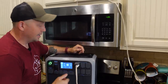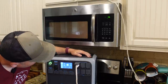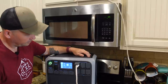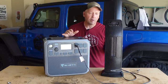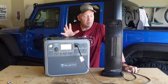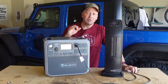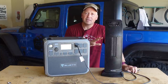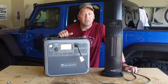What about your home microwave? Power goes out — can it power this so you can reheat food? That's a big microwave at 1,600 watts, but yeah, it can handle it. What if it's wintertime and the only option for heating is a little electric floor heater? On low it pulls about 600 to 700 watts; on high, up to 1,400 watts. You're not going to run it constantly — you'd get just over an hour — but cycling it on and off, running it on low, setting a cooler temperature, and recharging during the day with sunshine, it could get you by.